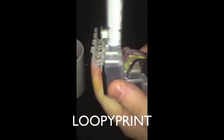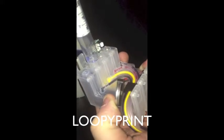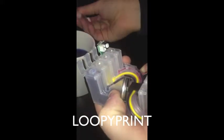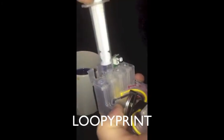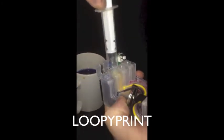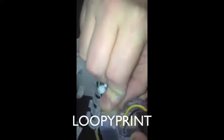Again put it into the hole and pull the air — watch the ink come up. Before the ink actually comes up, remove the syringe and get rid of the air, then push it back in and pull again. As you can see the ink is rising and it's now full. Take the syringe out and set that syringe aside because we're going to use a new one. Put the nipple back in and make sure you give it a good wipe so there's no ink.